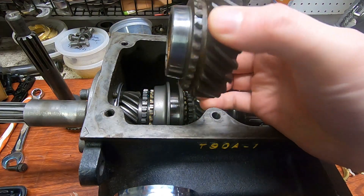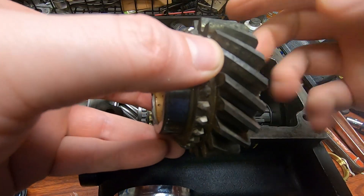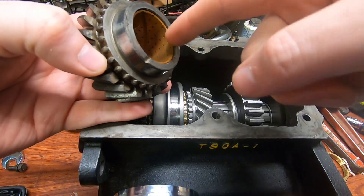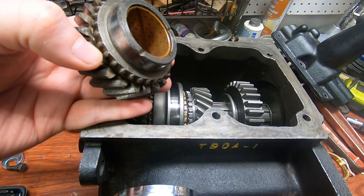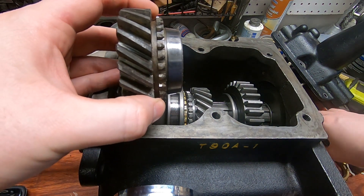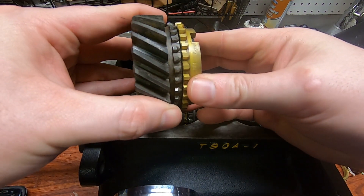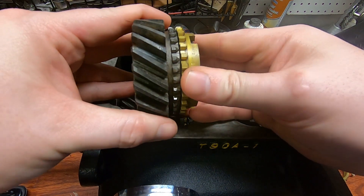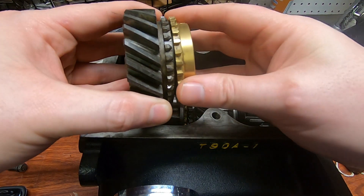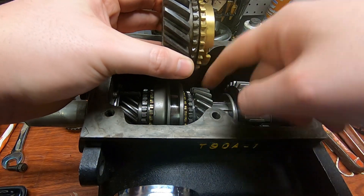It's kind of a similar situation with second gear. The chevrons were all chipped and rusted away, the gear teeth were severely pitted, so I wasn't comfortable reusing those. Plus there's a bunch of damage to the bronze bushing inside where metal debris was circulating around in there, so no good. We take the old blocking ring, we put it on there, there's just the tiniest little gap, but you press down on it and it grips. But even when you put one of these brand new ones on, there's a gap, but it's a heck of a lot smaller than what's here.